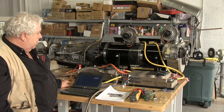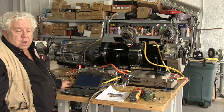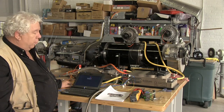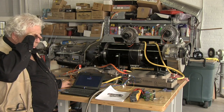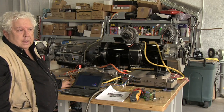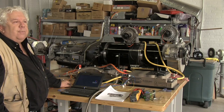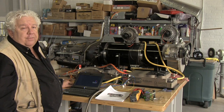And each of these can do 1,000 amps, and we're going to have a 190 volt pack. So that's, in theory, 190 kilowatts per motor. In practice, we will probably know from using the 1,000 amp Soliton on the Speedster Redux. We happen to know how these cells are going to react. They're going to react at 1,000 amps by dropping to 147 volts in the case of the Speedster Redux.